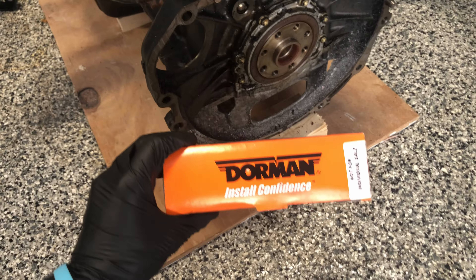This is the bolt I was able to get, and I'm happy because the grade is 10.9 category, so it's a pretty strong bolt. The dimensions are M12 with a 1.25 thread pitch and 70 millimeters in length. The idea is to put it through the engine stand, grab it, adjust it, and then torque it down.